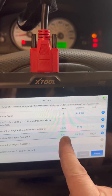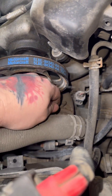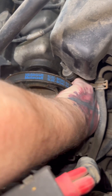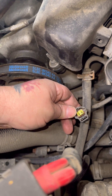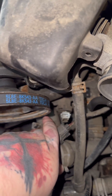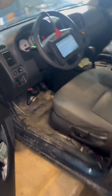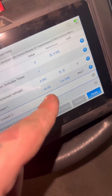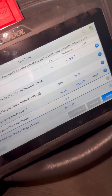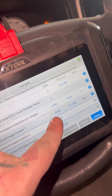Today it's about 50 degrees out, 60 inside the garage. The car drove in, so that should produce some heat — there's no way it's five degrees. We've got our air inlet off, and the coolant temp sensor is right here. We can just unplug it and look for corrosion — that looks nice and clean. Look for any breaking or cracking in the wire. Then we go back to our scanner and see what we're reading now.